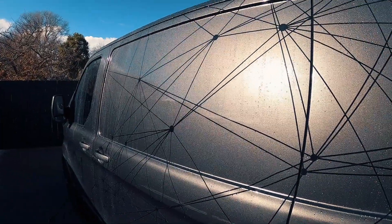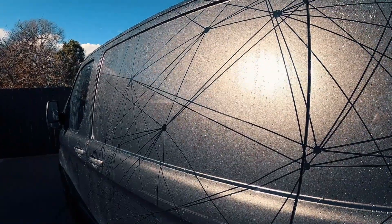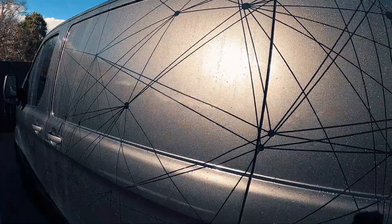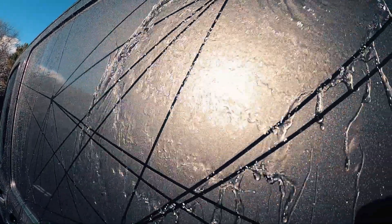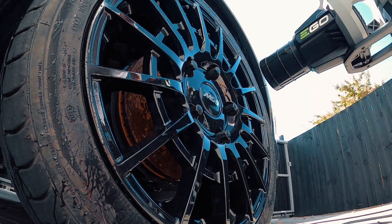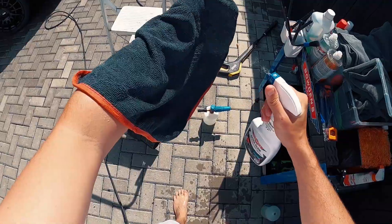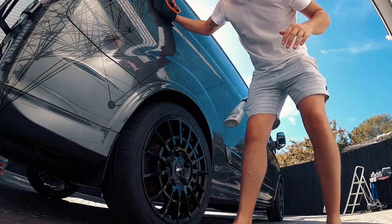As well as the water not wanting to stick to it at all. Now that you've got a super hydrophobic layer on your car, the next step is drying. I get asked a lot what is the best way to dry your vehicle — my cheeky response is with water. This is a process we call sheeting, where you flood the panels with lots of water and the panels behind are completely dry to the touch. You can only do this if you've got a super hydrophobic sealant over top. If you go around and flood the panels there's less water to dry, it minimises water spotting, and it's a really cool trick. Once you've water blasted all the Happy Ending off, I use the EGO 56-volt handheld leaf blower to get into all the little nooks and crannies you can't reach with a microfibre cloth. I then go around with a microfibre cloth and Bowden's own Afterglow — about five or six sprays into a cloth, wetting all the panels, drying panel by panel, then using a second microfibre cloth to dry the whole vehicle down.